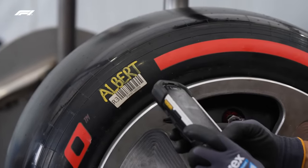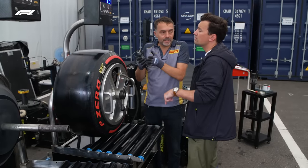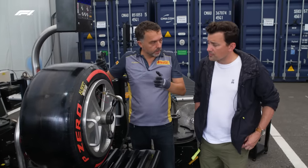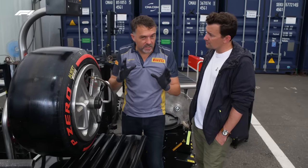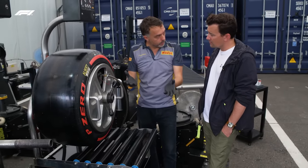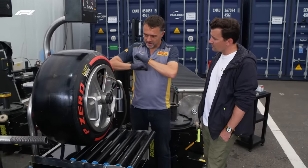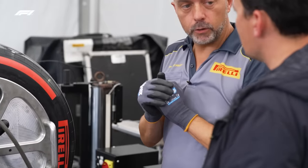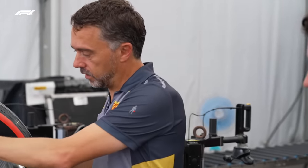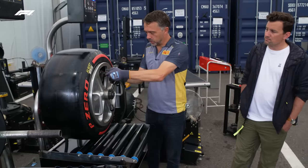You insert the barcode and record the pressure at which the tyre has gone and sealed completely on the lips. It's not so important now because the rims are all the same, but before, when every single team had their own rims, they wanted to know how much force the tyre employed to seat on the lips, in case there was any extra pressure or issue.